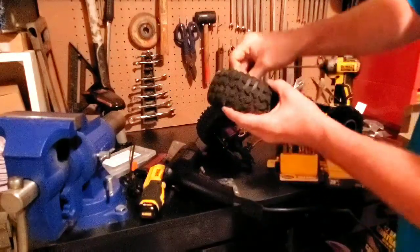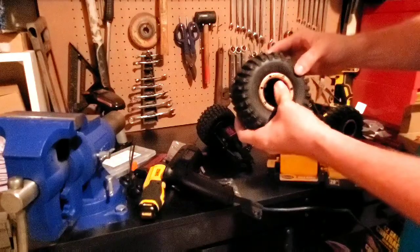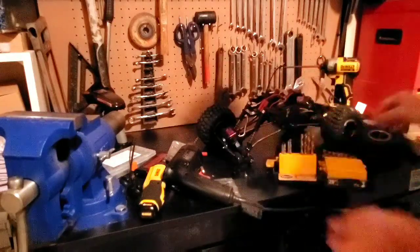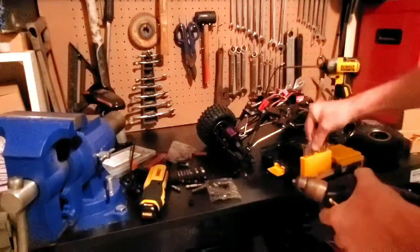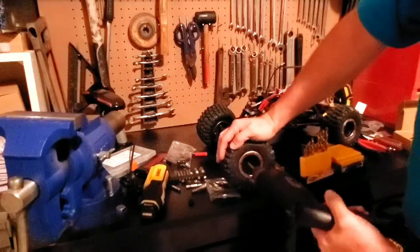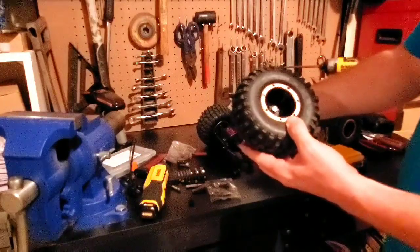Then try your nut again. The wheel nut will not actually go through the wheel. It starts to push in, but it's awful tight. It's too tight. It won't actually go through the wheel. So we need to go up the next size drill bit. Just one size. We'll try that. It's better to drill 3 times than to cut it out too much and have to replace the wheel. Hand away from the back. Poke another hole. Voila. The nut falls through. It's exactly what we're shooting for.